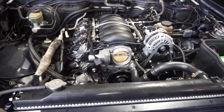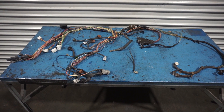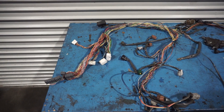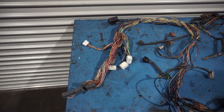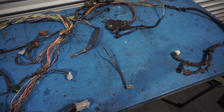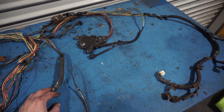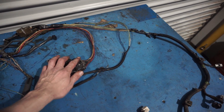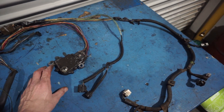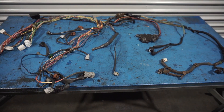We still need to make up the intake, but let's go to the body loom side of things as it's quite different to the manual variant. This is the 1FZ factory auto loom — I've stripped all the tape and cable sleeving off. The gray plugs that go to the ECU won't be needed, but the white ones going to the body harness are. Of all the plugs that went to the engine, we'll keep the one for the coolant temp sensor and all earth wires. We also have the gear selection switch — these wires control the dash lights, reverse lights, and the rest goes down to the transfer case.